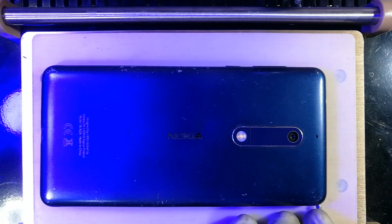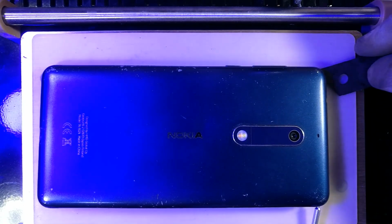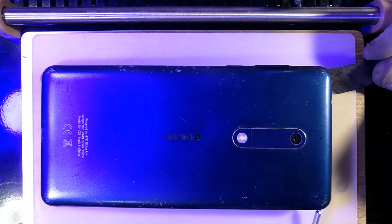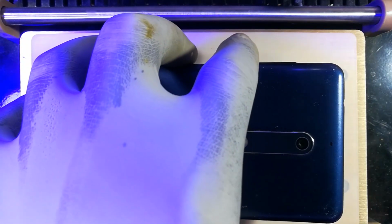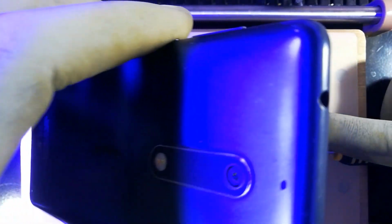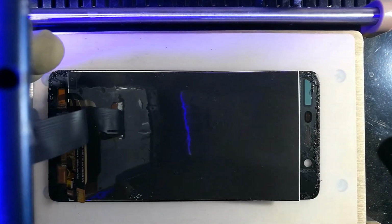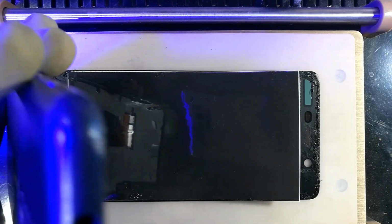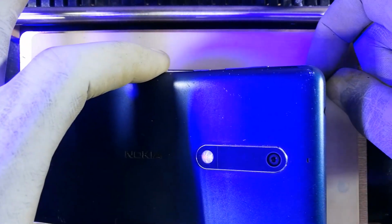Okay, so it's lifting. It's lifting. Let's reach out to that side and then lift it outwards. Now the layer that reflects light down onto the screen, the backlighting, seems to be lifting. I have to try to keep it down as I lift the screen, and this is how it comes off. Okay, I can turn off the suction and lift the screen out from the frame.